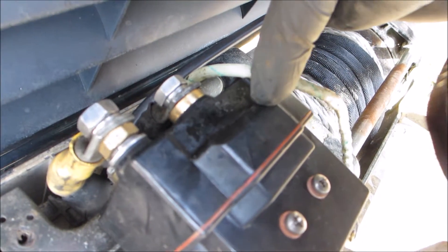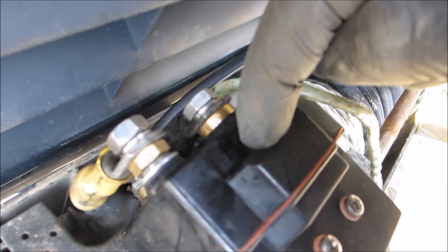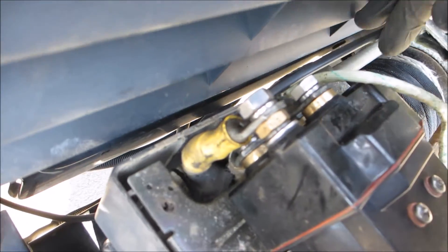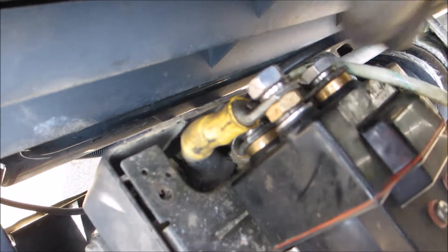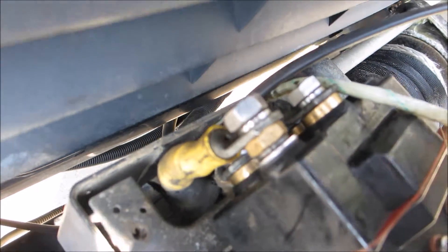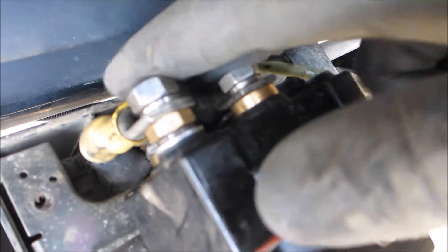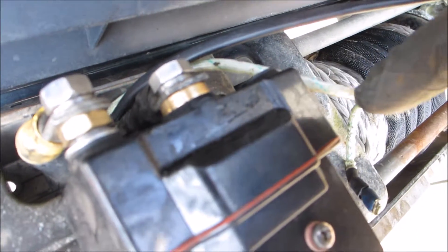You can see where the three-pin spades should have been — those are the ones that fatigued and broke off. Hopefully this doesn't happen again. This is just a little bit of twin flat I used for pulling the wire through, because it's easier to pull it through than push the wires up. A little tip for you. And then what I'm going to do is replace these now — undo all these and put the new contactor in place.